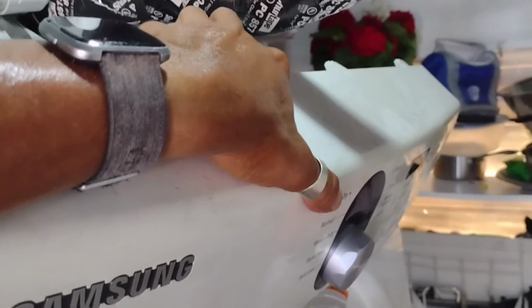You see it's moving forward now. Okay, so move forward. So what you're going to do, you're going to open the door of the dryer. The whole piece just comes forward. See, look, it just snapped forward. Okay, it has clips. You just snap forward, and then in here, okay? There's a little clip to disconnect it, but you don't have to disconnect it. What you need to do is just put it away, put it to the side, so it doesn't bother.